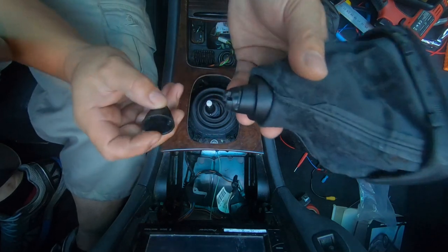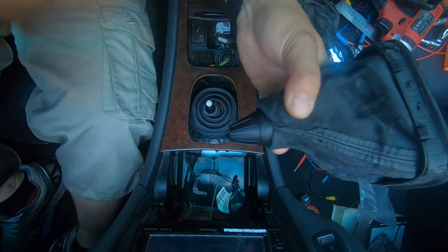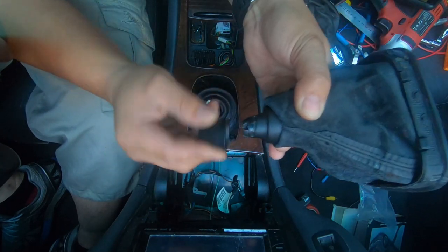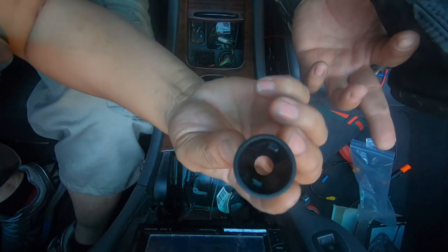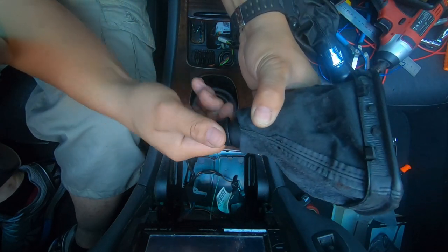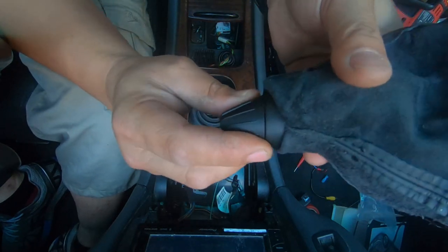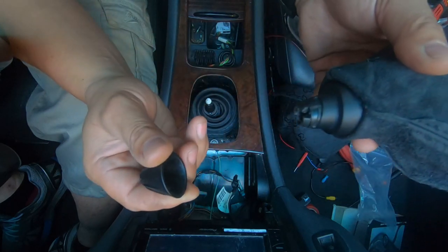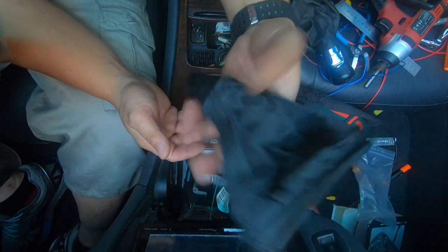And that's all there is to it. You go counterclockwise to lock it and clockwise to loosen it. As you can see, it has grooves in it — you can see the two tabs in there. That just simply sits in here, and you go clockwise to loosen and counterclockwise to tighten it back on again. That's why you go clockwise: once you go clockwise it loosens and then you can release it. And that's how you remove your gear stick.